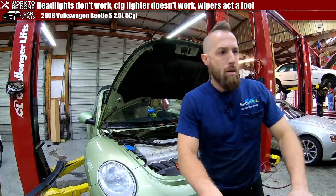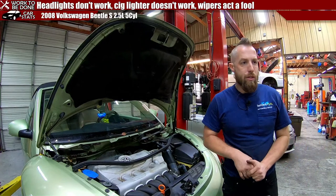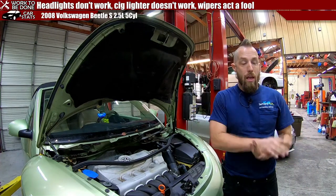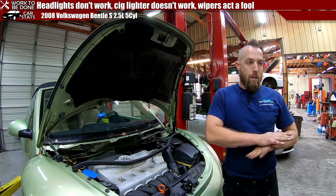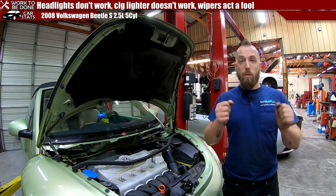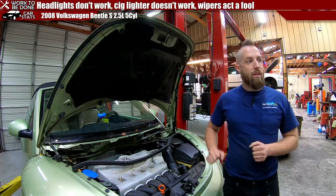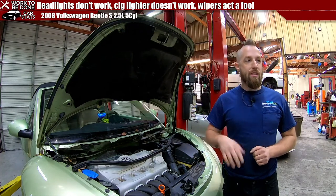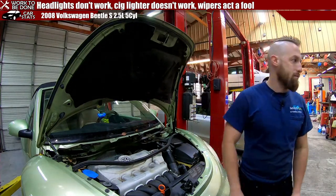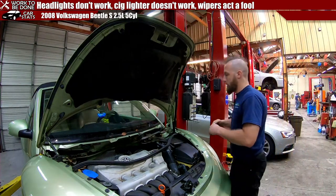How do you know if your car needs a new clutch plate? A really quick clutch test is put it in first, start accelerating, everything's going fine. You go up to about 15, 20 miles an hour, put it in fourth, let out the clutch, push on the gas. If it goes vroom, then your clutch is shot. Because it's barely holding on, and you'll probably blow it the rest of the way up. But hey, it's a test. It's slipping at that point.